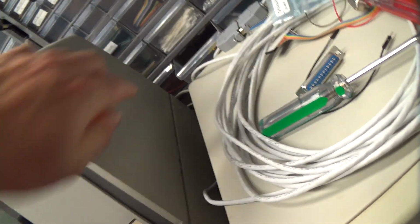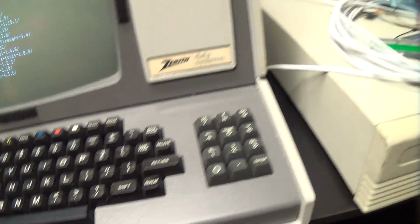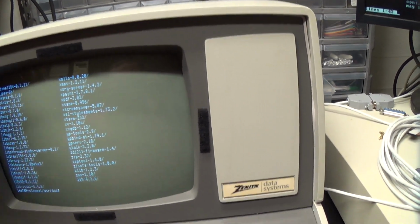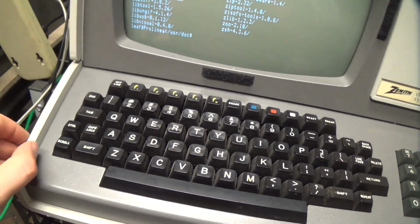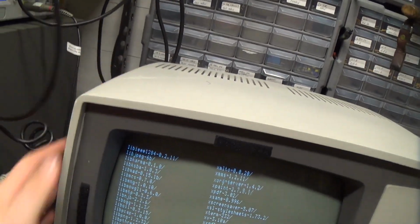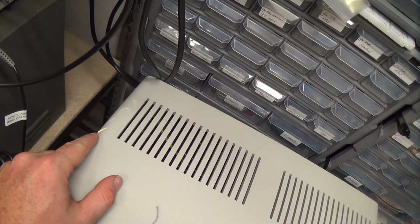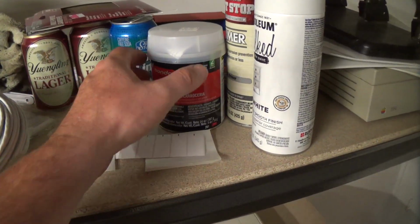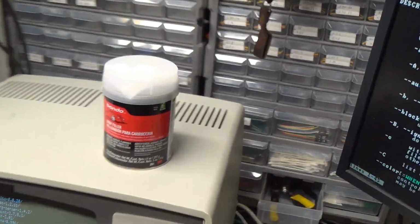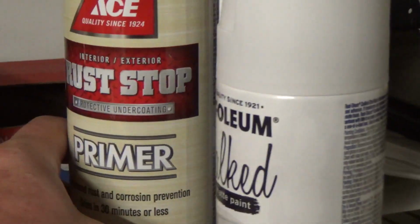There's some stuff on the side down there that's all messed up, and this is painted plastic here, so the plastic is mashed to where there's stuff sticking out where it shouldn't. So I'm going to just have to sand the high places out of it, and then I guess I'll have to get medieval in redneck fashion. I'm going to try to fill the holes after I sand the high places down with Bondo, and once that sets up, I don't think I'll need primer